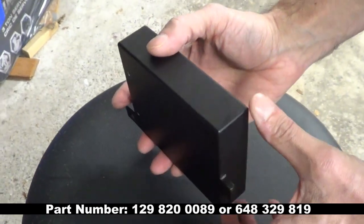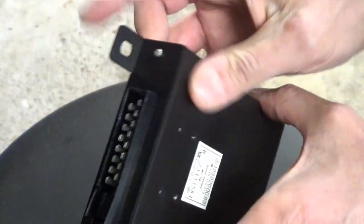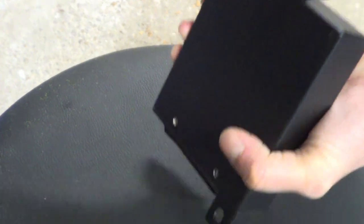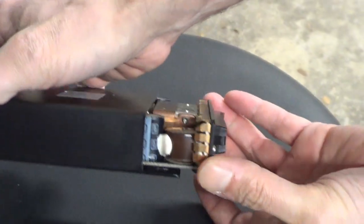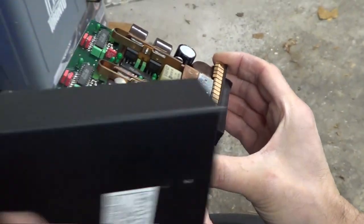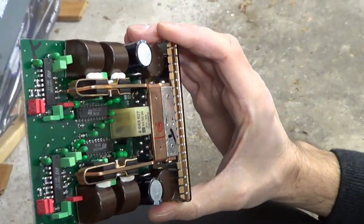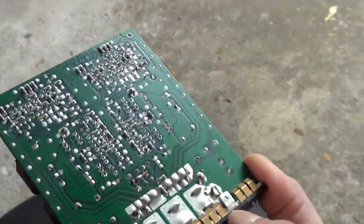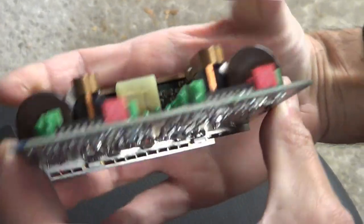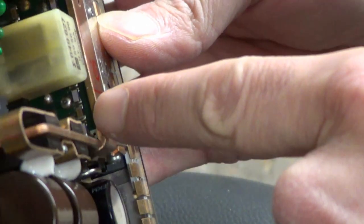What I'm holding here is the original bass amplifier. You're going to need one of those micro screwdriver sets — it's got four screws here and two there, six total, though you don't need to remove the two smaller ones. The whole thing kind of comes up once you pry at it. At this point I'm looking for faults. It's in amazing condition in terms of looks, but when I look closely I notice maybe a little bit of corrosion — not crazy, but it's there. And if you look inside, you'll start to see there's a little bit more corrosion.